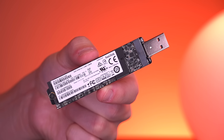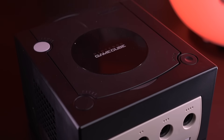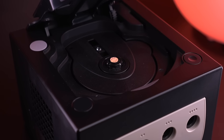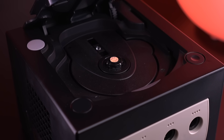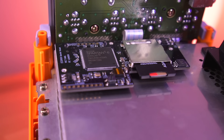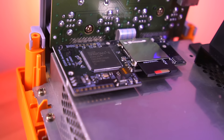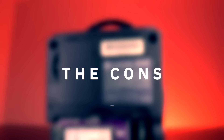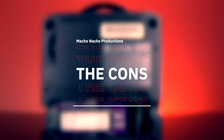I'm using this no-name USB 3.0 adapter and it works great. One of the very big benefits of the M.2 Loader, much like the SD Gecko and SD to SP2 adapter, is that we get to keep the optical drive. This is one of the greatest benefits of using this method over an optical drive emulator like the GC Loader. While I absolutely love the GC Loader and the benefits that it brings to the table, not being able to keep the optical drive is one of the major drawbacks. So while the M.2 Loader has some pretty major pros, there are a few cons, so let's get into those.